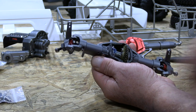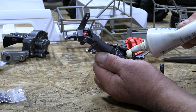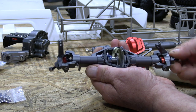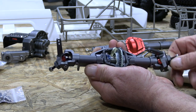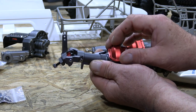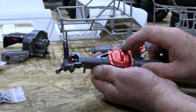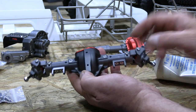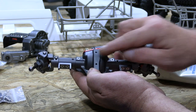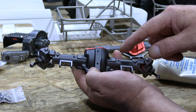There's the rear done. Now here's the front — kind of the same thing. Let's go ahead and put a little bit of grease in that. I'll show you how I turn it. That looks pretty good. There's only one way these will go on, by the way, which is good to know. I also noticed these holes — one here, one here, here and here — and I'm going to put some grub screws in there to plug them up with some loctite so it seals them.